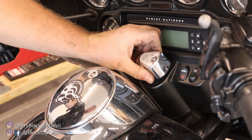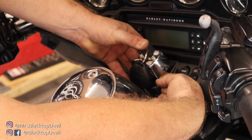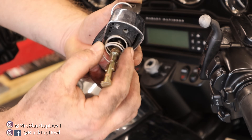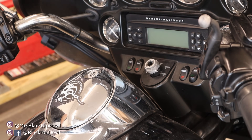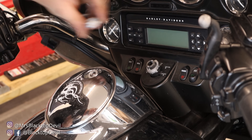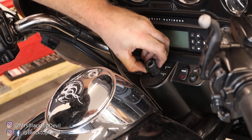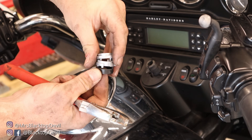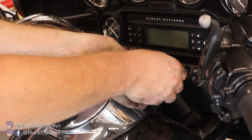Next, turn your ignition — there's a little tab under here, push the key in, push the tab up, and the whole ignition will pull right out. There is a spring on the bottom so make sure you don't lose it. Then loosen this nut here, pull it off, and there's a little keeper that slides off too. There's also a little plastic spacer underneath. I always put stuff together the way it came off so I know the order for reassembly. There's a little plate underneath that should pop right up.